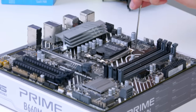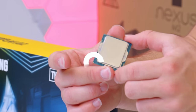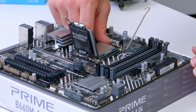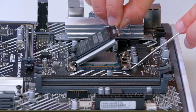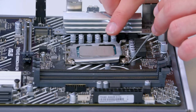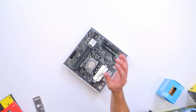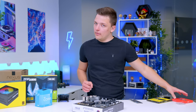We're going to pull up the arm on our CPU socket and then pull up the cover itself. Next up, locate the golden triangle on the processor — ours is just here in the bottom left-hand corner — and we're going to line this up with the corresponding one on our motherboard's CPU socket. We're then going to close the cover back down, applying a bit of force, which will make the black plastic cover slot off, and then we can secure it back down with the arm. It's slightly different to Intel's last-generation lineup, a bit more complicated, and the socket's definitely a bit more delicate.